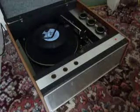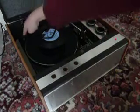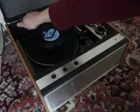When you receive it, the first thing you'll need to do is to screw down the two transit screws on the record deck, located here and here, and screw those all the way down fully clockwise so that the deck floats on its springs.